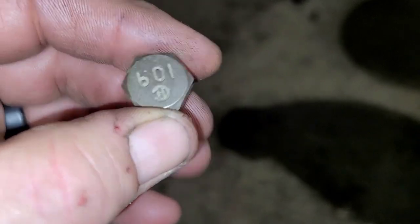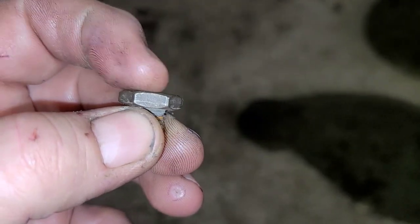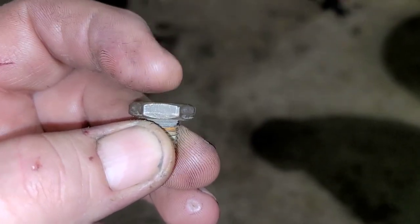Put the right hardware in, because you could destroy it — you could even puncture a hole in the converter. Also, this bolt has a shallow head so it clears between the flex plate and the back of the block. I saw a 4.3 Jimmy years back making a god-awful squeaking noise, and somebody had put in four bolts with heads so deep they were actually cutting into the back of the block. You should be able to feel that as you're rotating the motor.